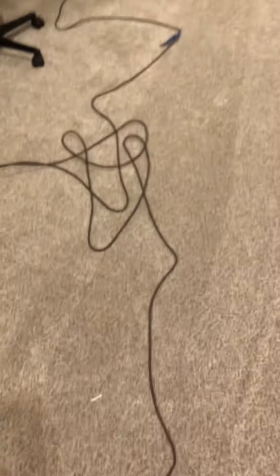So let me show you another problem — there are holes in the hose, and this hose is so nasty so I will replace it. As well as the cord, because the cord that was on this thing was preventing it from turning on. Luckily I had an extra cord from another Dyson DC-33 that I fixed, so I put that one on this one and it works good. But I'm still going to replace the cord because there's a cut in it, to prevent electric shock. Let's do a hose test — I'm going to hold the part where the holes are and see how it does.